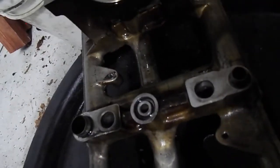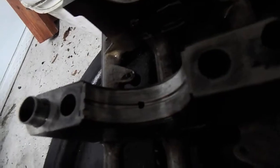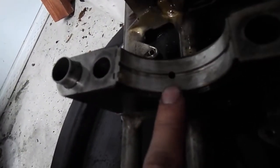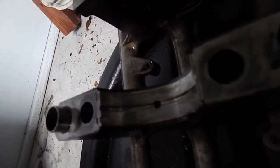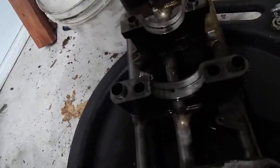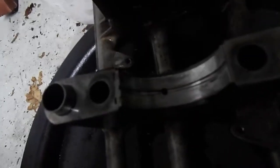When that O-ring goes out, not only does it create a loss of oil pressure, but it also prevents this bearing from being lubricated. If this bearing isn't lubricated, it gets chewed up and scores the crankshaft, and it can create a bunch of metal flakes in your engine. The metal flakes can clog up your oil pickup tube, so if you see metal flakes in your oil pickup tube, maybe you should also check this.